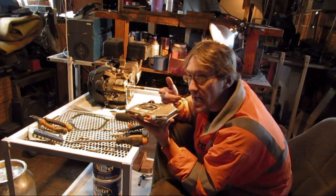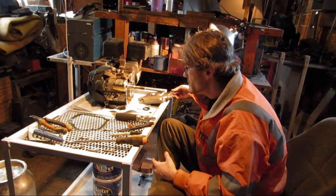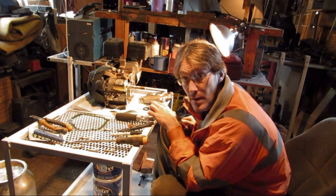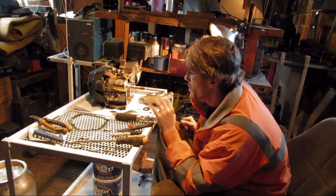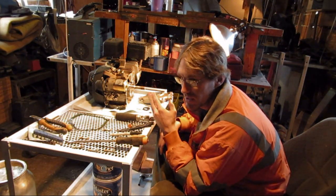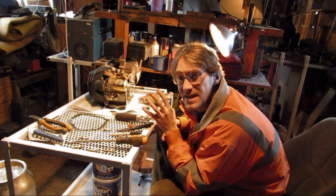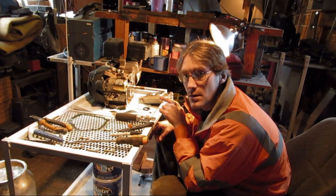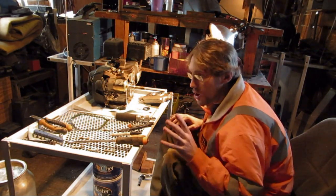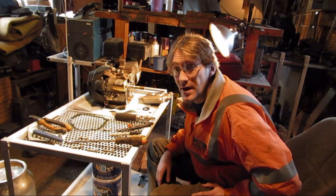I've had this engine for four years. It's on the Batmobile and it's on the bike right now. I'll show you what the oil looks like — it's pretty gray. As the oil was draining, I noticed there were a few little bubbles in it, but they weren't bubbles — it was water. Regardless of how well sealed your engine is, you'll always get some water in it through condensation. If the engine is cool and the outside starts getting warmer, you get condensation on the inside of the engine, so it's literally impossible to keep all the water out of your oil.